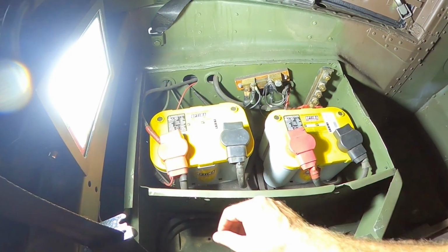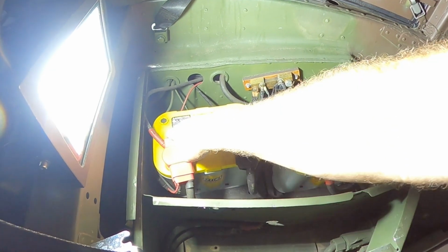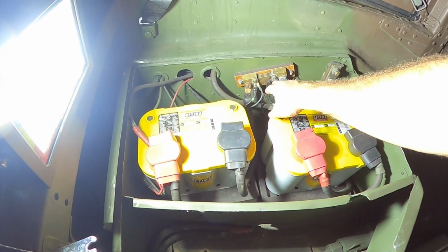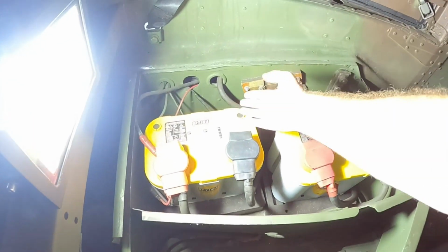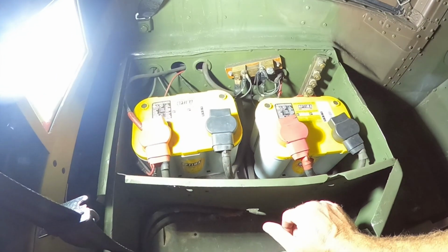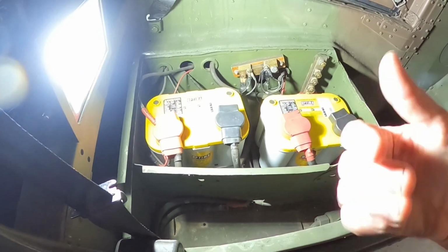So you're already seeing power wire from that, and it loops up. I have run into the battery, which, like I said before, isn't the cleanest thing in the world. So this gives me an opportunity to clean a lot of that up, run my 12 volt around from here, tying the 12 volt bus in, and then wire everything to that. Same thing with the ground. I want to clean some of this up and go to a singular ring for a couple of the wires that are jumped together, and just tie them into the ground bus, and probably take this guy off and wire it straight to the ground bus as well. It'll just clean things up a little bit, and we'll do a loop from here to the ground bus itself. I just think it'll clean things up a lot. So anyways, let's get it done.